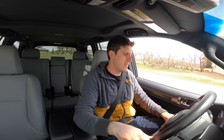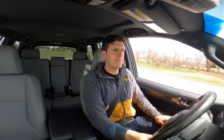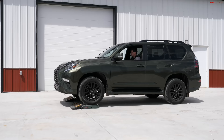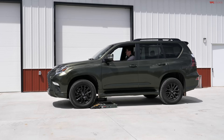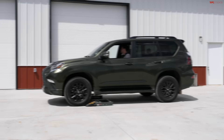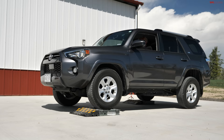Now to fix this issue altogether, you push a button — down here by my knee, there's a little diagram with an X between four wheels. That's going to lock up the center differential. Once it's engaged, the front and the rear drive shafts are spinning at the same speed. So in the 4Runner, when you engage four-wheel drive high, the front and rear drive shafts spin at the same speed — it's kind of like locking the Lexus GX into four-wheel drive with the center diff lock button pushed.